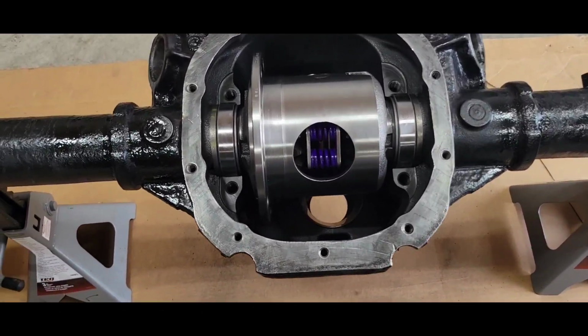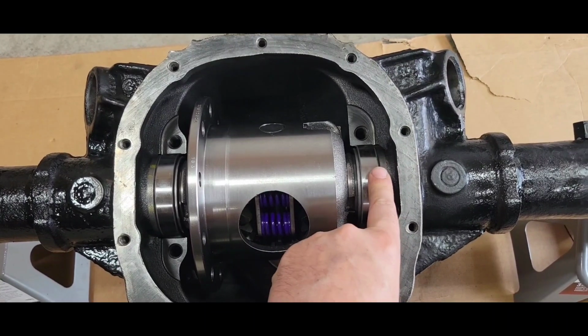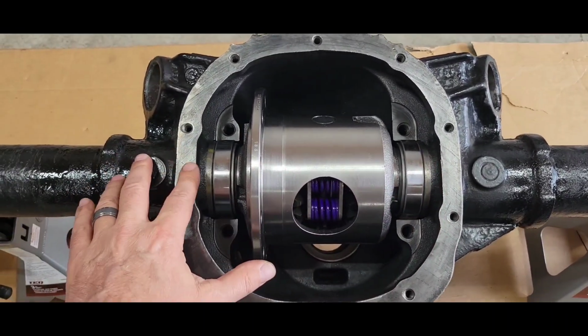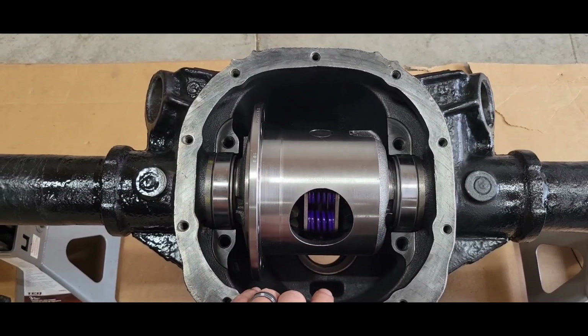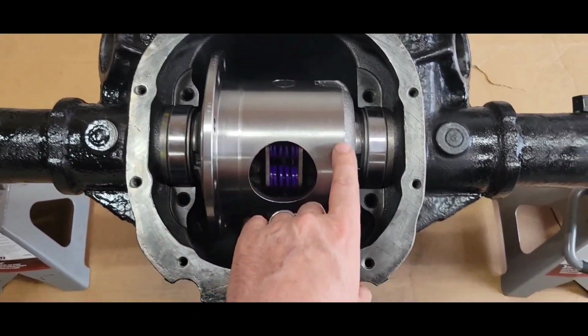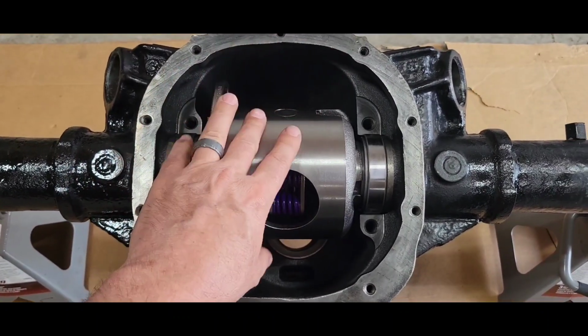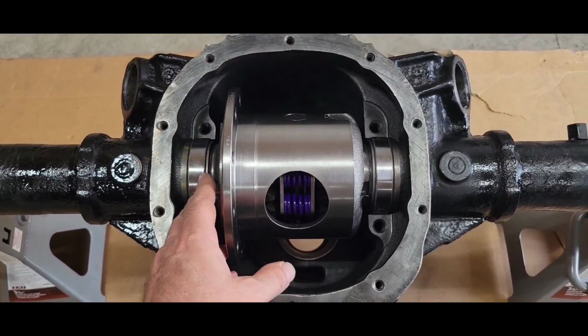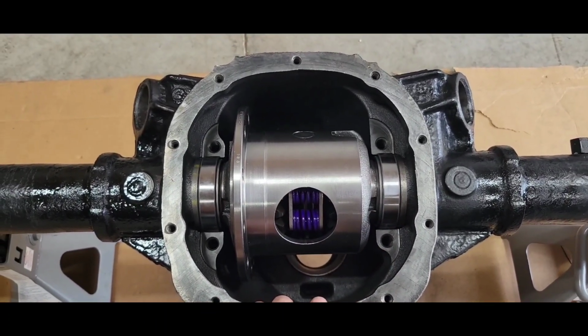Well, after some research, I got some pretty good information about using the stock shims they came out of to get you a good baseline on your preload. And this is all assuming you get the bearings shouldered out like they're supposed to be, everything's deburred and laying in there real nice. But yeah, you're supposed to actually pound them things in pretty good.